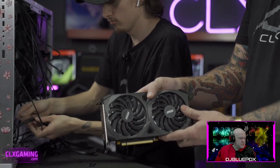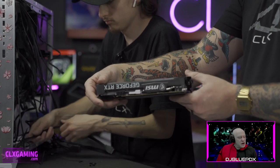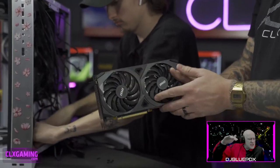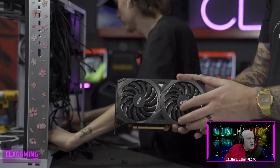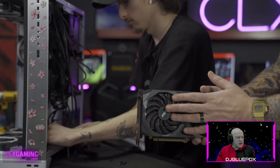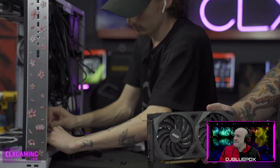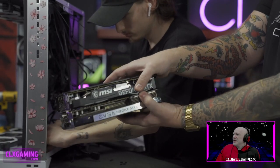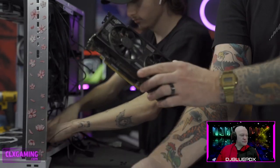Let's look at how a video card's cooling array works. We have a 1050 Ti here that we've used before for demonstration — we're going to pull the cooler off it. Most of the bulk of a video card is just the cooling solution, which is typically a thick block of metal with fins and fans to push air through those fins.